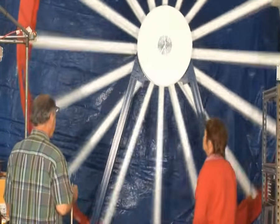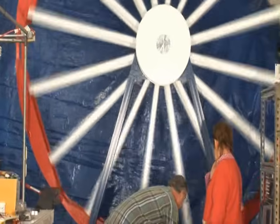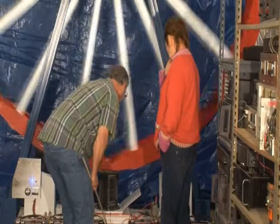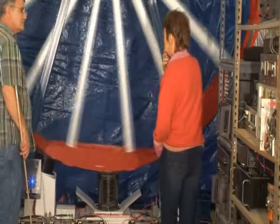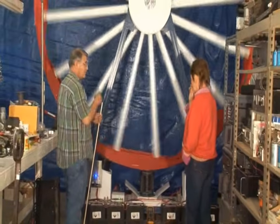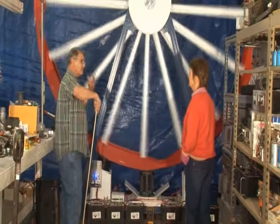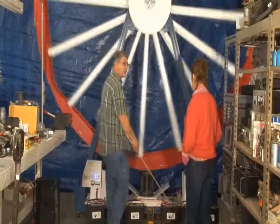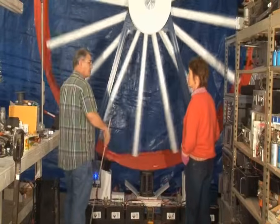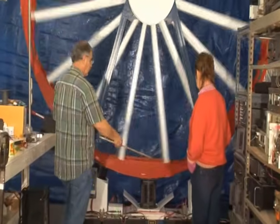If we tell it, see how we're tapering off on charge? Now we're starting to really taper off. It's at 39 then, 38.4. Yeah, it's charging pretty quick with this current. So pretty soon it'll be at 40, and then at 41, and then pretty soon it'll be at 43. And these batteries are boiling at 14.8 volts or 14.5 volts. Your car doesn't like to take your car battery over 14 volts because you'll boil it away.